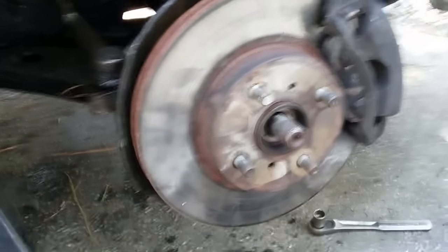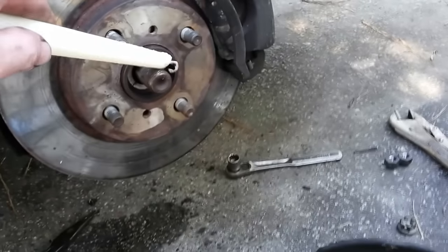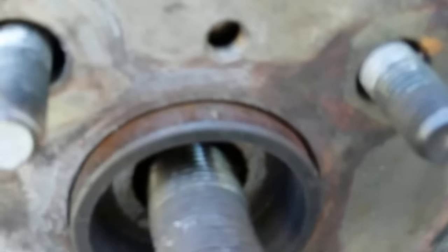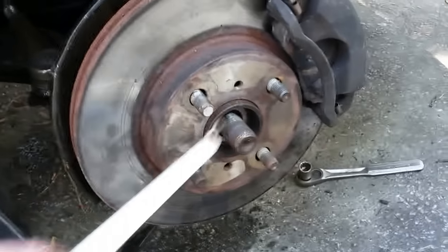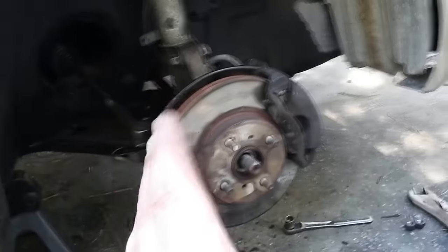And here's the trick. Once that thing is hot, you want to go inside and find a candle and start rubbing the candle around the CV. The heat is going to suck this wax right in. If you can barely see a little bit of shine on there, that ain't PB Blaster — that's the wax. Repeat. You may have to do it two or three times: heat, heat, wax, heat, heat, wax. It'll get it. Right about the time you're ready to give up, it's going to pop free.